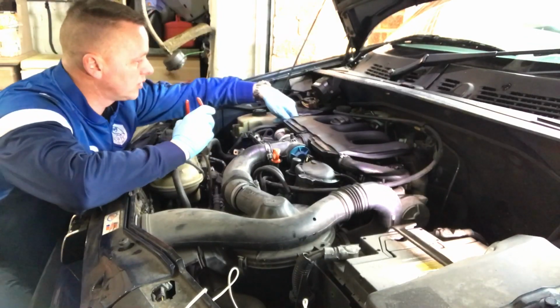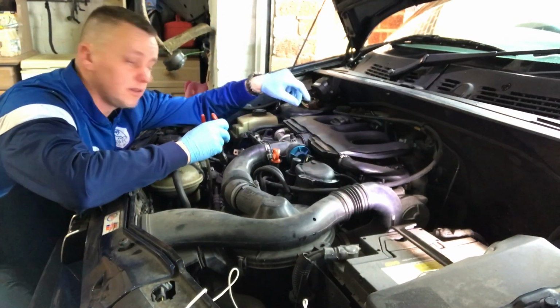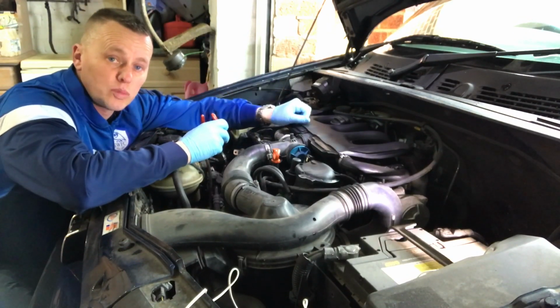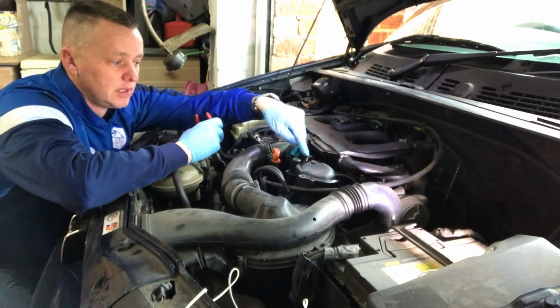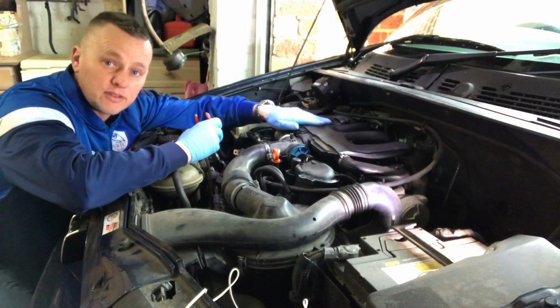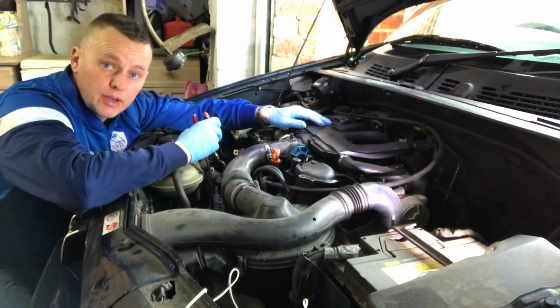So I've had a look and I've got a bit of residue underneath the manifold. Looks like I might have a fuel return pipe that's maybe got a little crack in it, or it's leaking in some respect, which is causing the air to trace back through the fuel system, giving us this airlock. So it's a real pain. I've got to take the manifold off the top. Can't get at it else. So let's strip it down and see what's going on.